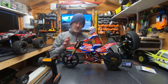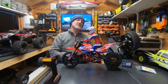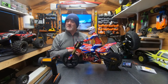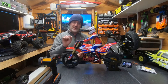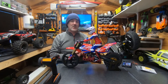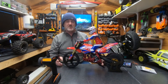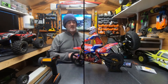The brains of this operation: it's running on a 540 size brushless Leopard motor, basically a 3200 kV motor — a real good little punchy motor. And don't forget, it's just rear wheel single drive, so that's a lot of power going into that one wheel. That is coupled up from the motor with a 60 amp ESC, which enables you to run either the 2S or the 3S.